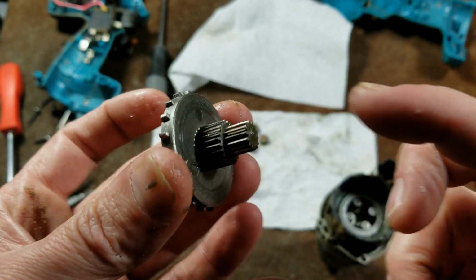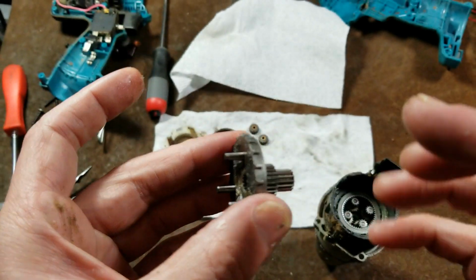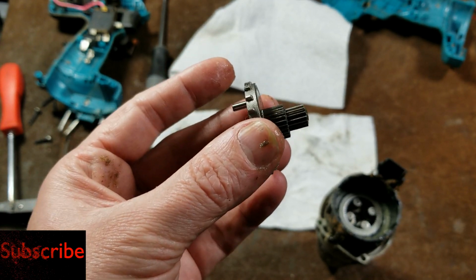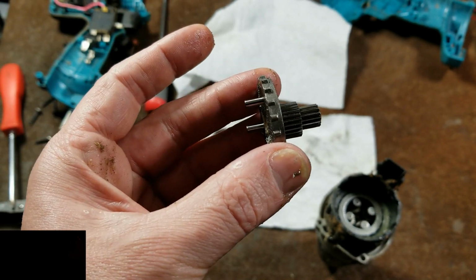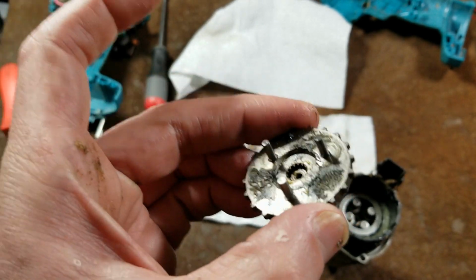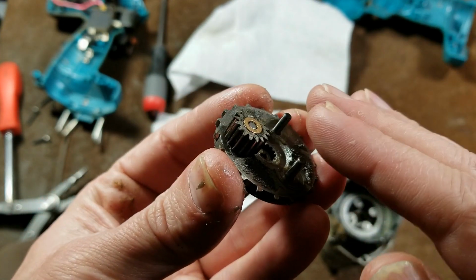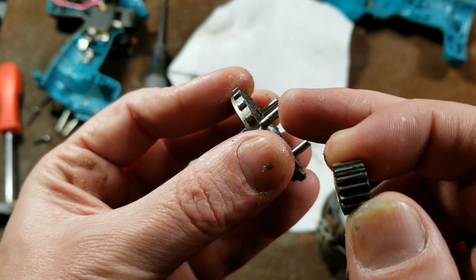DeWalt does the same thing, but DeWalt did a patent to where their gearboxes are all held together with plates on both ends of all these pins. Makes the gears really straight, makes all the power get delivered in a much more even fashion. And it really helps them take the power that they put out now without actually having particularly larger gears, just because they maintain essentially perfect alignment. Technically, the issue with these pins, without being reinforced, which is basically in all cordless drills besides the DeWalts I've seen, but other high-end planetary gearboxes often have support plates on the back side, because when you're putting a lot of force here, technically these little pins will bend or deflect a little bit.